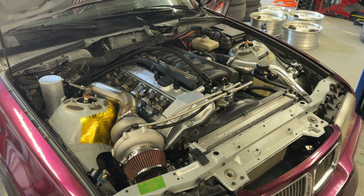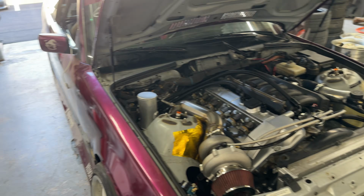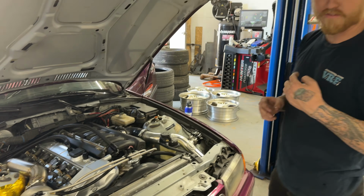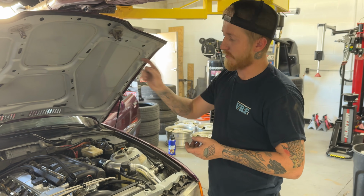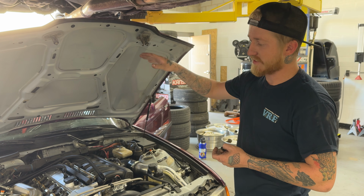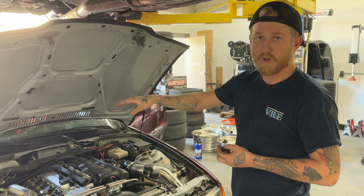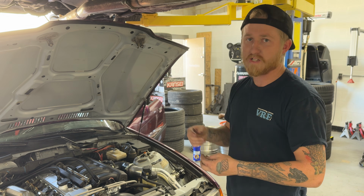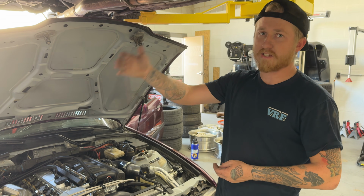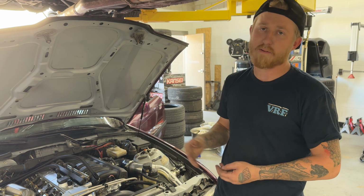I'm going to run you guys through some of the ECU setup stuff, and then we'll try to fire it up. Yeah, and then one thing that I didn't find info on is that auxiliary plug on the back of the ECU. The wiring schematics between the Megasquirt and some of the parts that I use, like the AEM Uego wideband, they chase their tail, because the EFI Analytics website kind of tells you to check the ECU's diagram, but then the ECU's diagram isn't very well labeled.